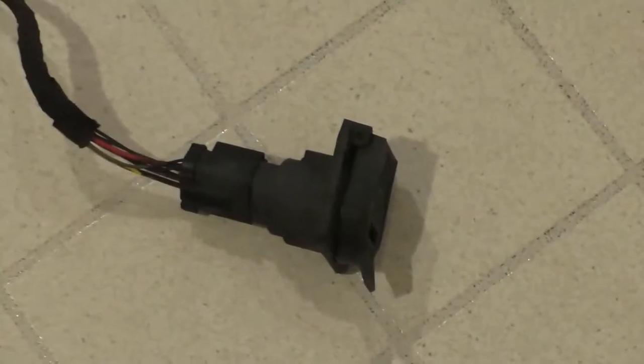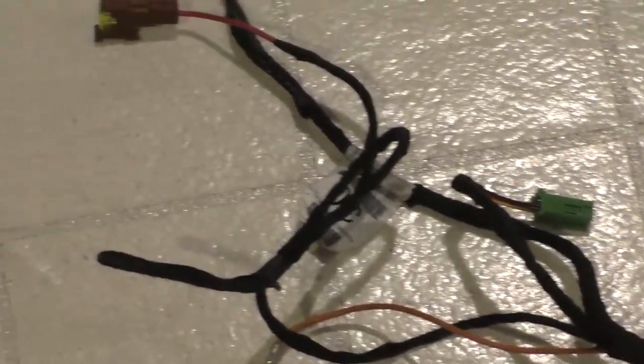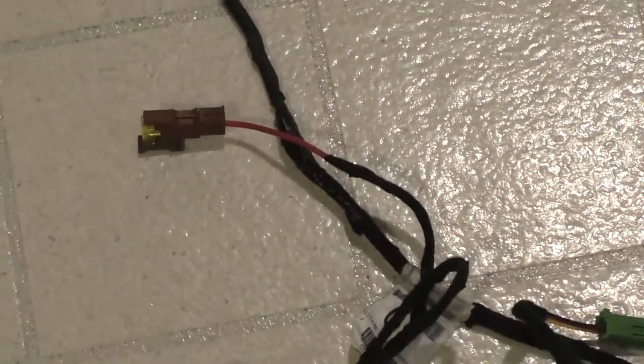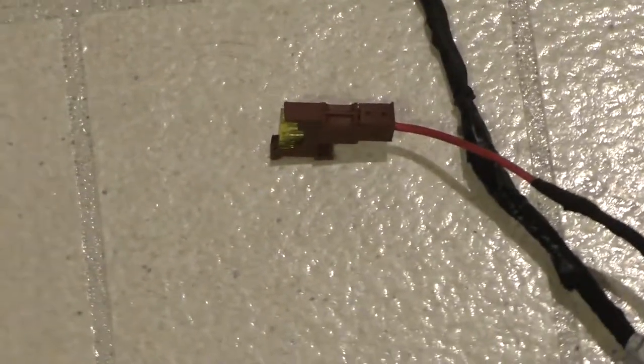This is the new fabrication from the hitch connector along the harness that goes under the hitch, under the horizontal bar of the hitch, through the grommet that goes into the shell of the vehicle. There's a green plug that plugs in just inside where that vent and shell are. And then we have inside the vehicle where the fuses and relays are, just immediately inside on the passenger side in the US, right rear. And then we have the power source in the form of the fuse that taps right into that rear fuse box.